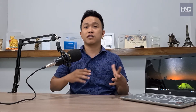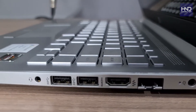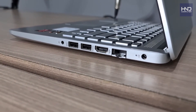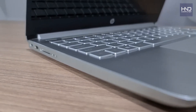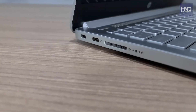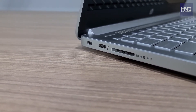For connectivity, the HP 14s-dk1005AU is quite complete for a slim laptop. On the right side there's the charging adapter port, next to it is a Gigabit LAN port, then an HDMI port for projection to a projector or LED monitor, then a SuperSpeed USB Type-A port at 5 Gbps, and a combo jack for headphones. On the left side there's a Kensington Lock port, a USB Type-C port at 5 Gbps, and a card reader slot for an SD card.